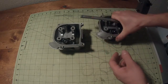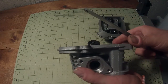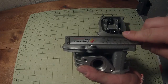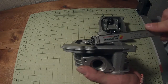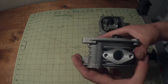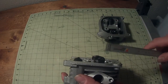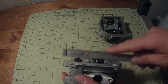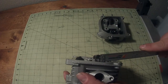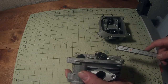Now let's look at the 69mm. If you look here, you can see the 69mm goes past. When I put that on the lip and I slide over, I can't go any further — I hit the spring right away. If you look at the air fuel mixture side, it's much more prominent. You see that thing sticking up? There is no way I can slide that over. It is not equal to or below the lip of where you bolt on your valve cover.